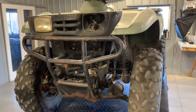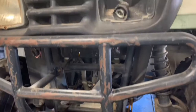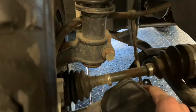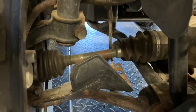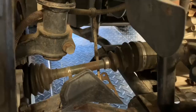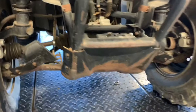We've got our headlight assemblies up top — this front end has been beaten up; we're missing a headlight and the front rack. You've got driveshafts here, and on the other side we're missing one — it's actually broken. You want to inspect these boots and make sure there are no holes or grease coming out. If there is, replace those immediately or you'll be replacing the driveshaft. A boot replacement is about $15; a driveshaft is $185. I've done a comparison video on unbranded versus OEM versus high-quality aftermarket axles — a cheap axle could cost you your differential.